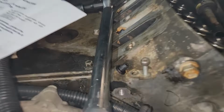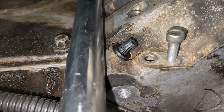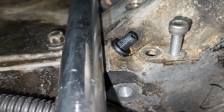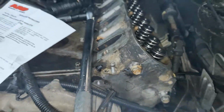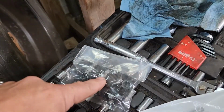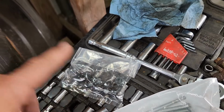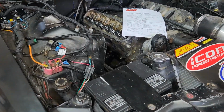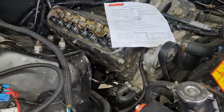Yeah, same thing on those, except those washers don't have that serration on the bottom of them. They're slick on both sides, but those only get torqued to 28 foot-pounds. Not going to matter much. But again, you do want to grease the bottom of the nut. You want the nut to spin on the washer. You want the washer to act like a piece of the head. You don't want it to move, because if it moves, it'll mess up your torque reading.